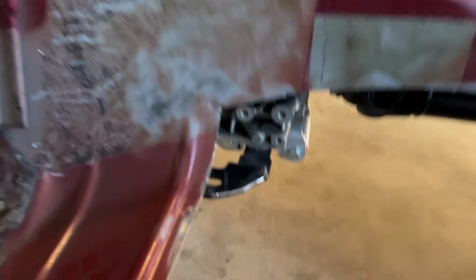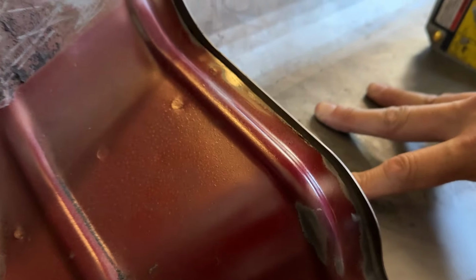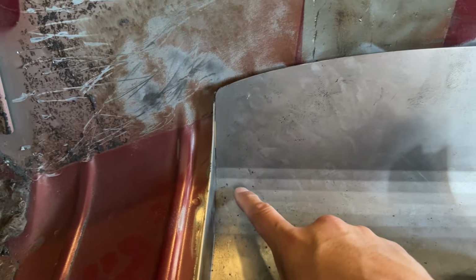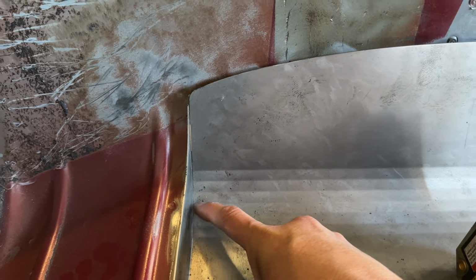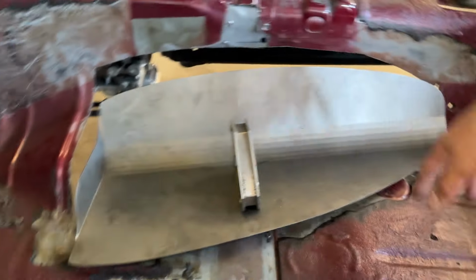And I cut some metal back, you know, I got it nice. Let me see if I could get this with one hand. That's as good as it's gonna get. And that's pretty close. That's not bad at all. I'm just gonna weld it in like that. It is touching, it is grazing back there, but I think once the plate's mounted, I'll hit it with a little bit of hammering over there just so I can mount and dismount the trans whenever. But I think we're ready to prep the metal all the way around and start welding.